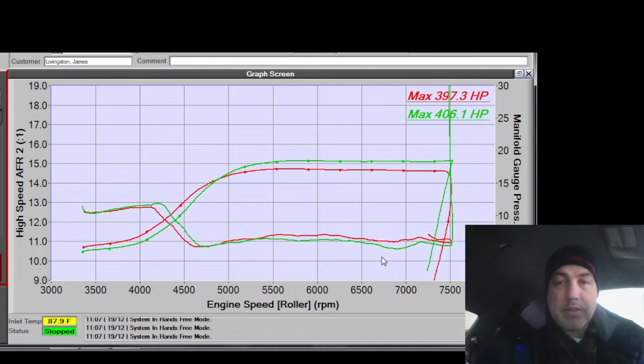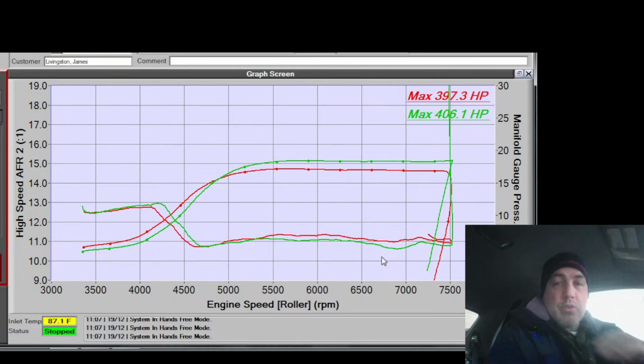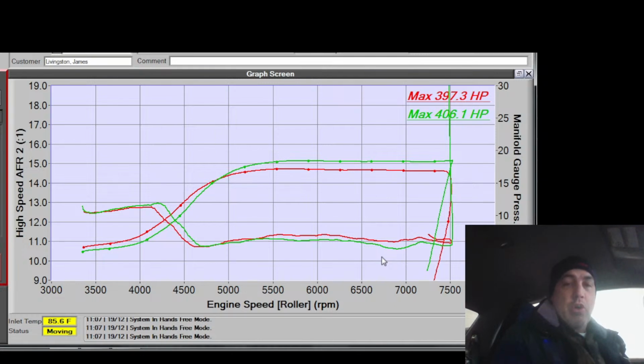Because then that means a big change of wastegate duty cycle has small changes in boost, which means I get very good and finite control. If it's like 2% is 2 pounds, that's an issue, because that's going to change based on temperature dramatically. I like having lots of resolution. It makes sense to me. So I want my ethanol wastegate duty cycle to be like in the 60s or 70s, and my pump to be in the 40s, something like that, so that I have the ability to get finite control with changing conditions and without inducing oscillations and things like that.